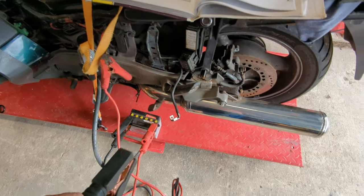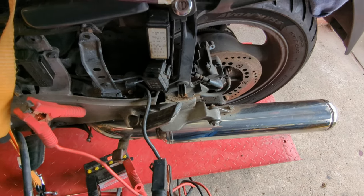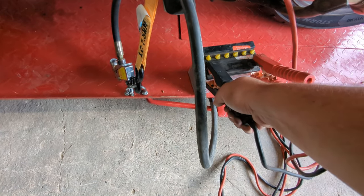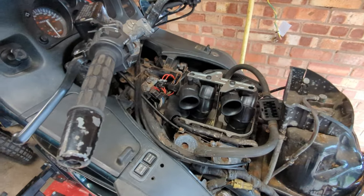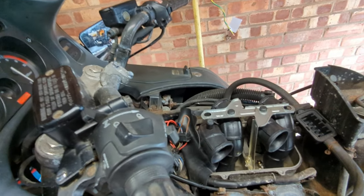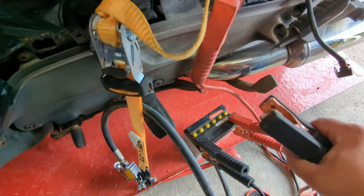Battery jumper-cabled up to the positive, fully expecting we're about to get deafened. I heard a creak but nothing else. We got decent connectivity. There's a crackle coming from that alarm, but nothing more than that. So let's see if we can hotwire this quickly — I expect we'll get deafened and if we don't we'll count our lucky stars. There's a beep. Right — it's got a motion sensor on it. We'll disconnect that, kind of preempting this from past bikes I've worked on.